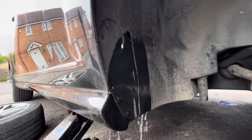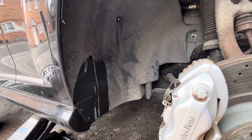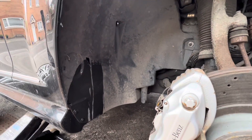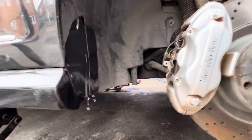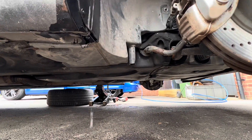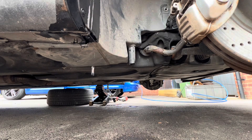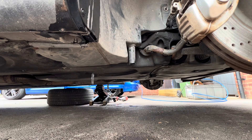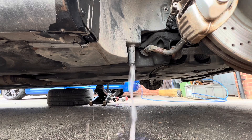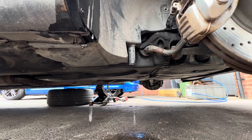I think you can agree that she's all fully functional again and not backing up. We'll repeat on the other side — although I don't think the other side's as blocked, we'll double check and clean all those drains out. I'll just show you as well that that center drain is working — that's the tube that comes from the center of the windscreen from the bonnet. As you can see, that one's all working as well. So we'll go and repeat on the other side.